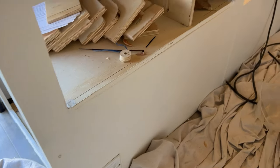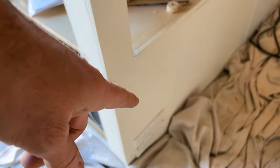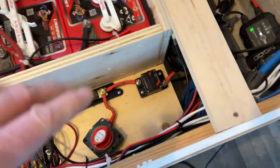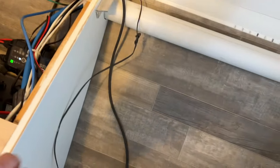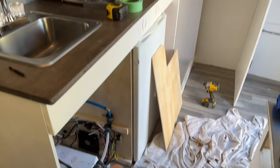Most of the electrical is done. There's a propane sensor mounted low to the ground — propane is heavy so it drops down, so you want the sensor as low as possible. All my electrical is wired in: main disconnect, solar disconnect, solar controller at the back, and a 110-volt charger. I'll probably run 110-volt out to the face of the cabinet somewhere.